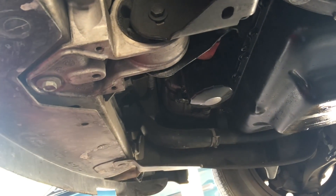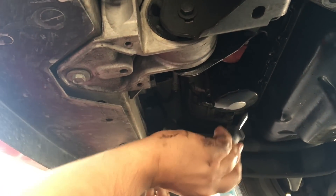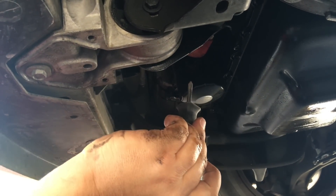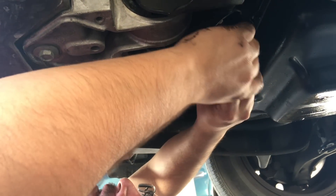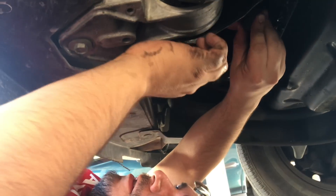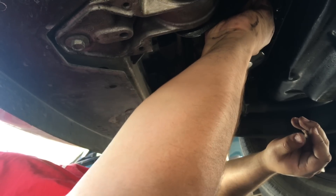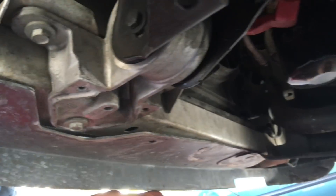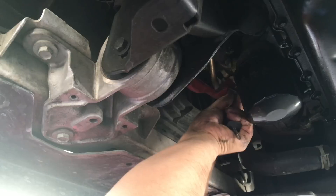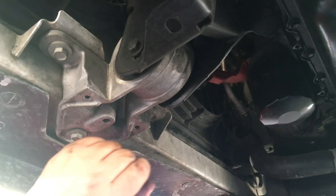Let's see how we can get that connector to let go. I think I'm going to need a screwdriver — this little tiny stubby screwdriver. A little push on this plastic tab. Having glasses and working under here is a blessing and a nightmare at the same time because the light reflects off them, but it also protects your eyes. Pull the tab, slip off the harness. Everything is moving so nicely. This is so far the easiest starter I have ever started changing out, honestly. Very simple. We'll just move those things out of the way and it gives us easy access to our first bolt.